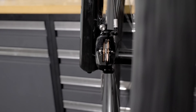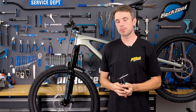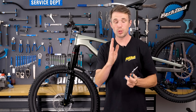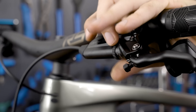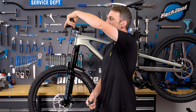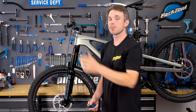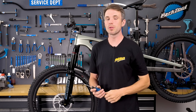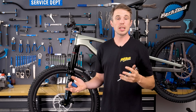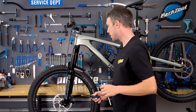The join mark of this caliper serves as a great tool to aid this alignment. So that's the caliper lined up with the rotor sitting centrally. Now if you're using a SRAM brake, you want to put the bite adjust all the way inward — fully counterclockwise — and the lever put in closest to the bar. This is just going to give us some more wiggle room and require less effort at the pistons. If you've got a Shimano system or another brake system, it might not need this; they tend to be a little bit easier to do.